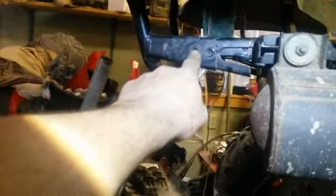So this is what I put on. Got this on to mount onto here. You can see that the holes don't line up there. I'm going to have to re-drill those. But this does match up with that. That's going to hold that. You can see where I cut it here. You can see it right there. Cut that. I had to cut these out for relief for this muffler holder where the other one didn't have it.